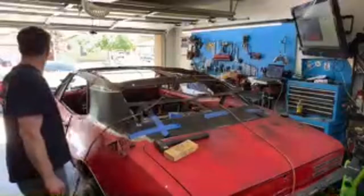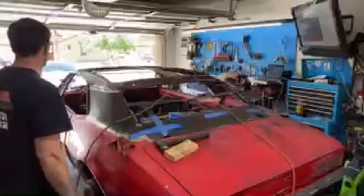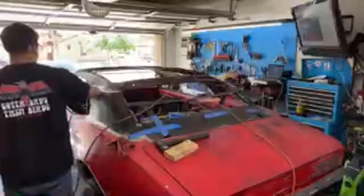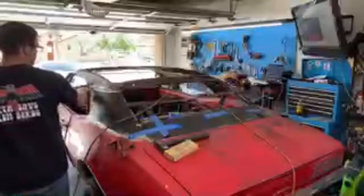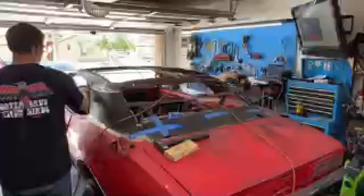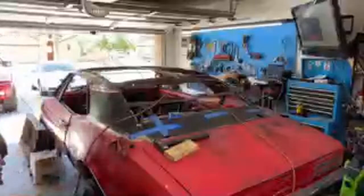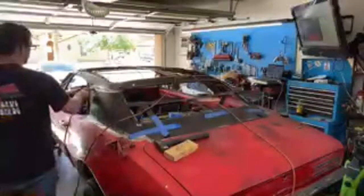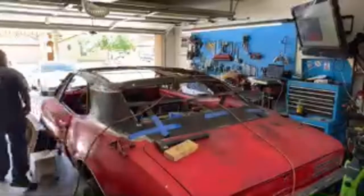So I probably should wipe that down with some alcohol and give it a buzz cut, and we'll retest fit the roof panel, see if I got it cleaned up in the front. Weld-through primer too. When you do the weld-through, yep, I buzzed the EDP coating off. So go ahead and hit where I took the EDP coating off. With that copper color stuff, just go ahead and do that whole line right there, copper. The whole thing. Because I'm going to weld through that. Okay, that was great. I'll probably, once I get the roof panel placed, take a wire brush and take the copper off. But whatever's behind it, it'll at least be painted. Yep, I get you.